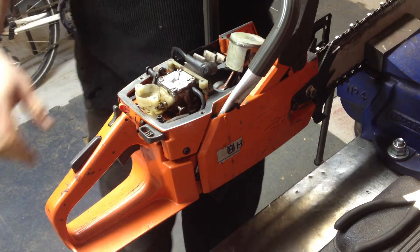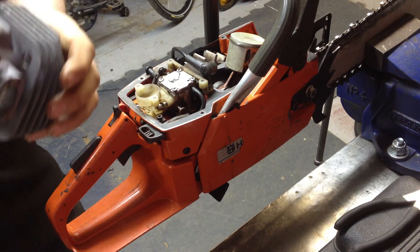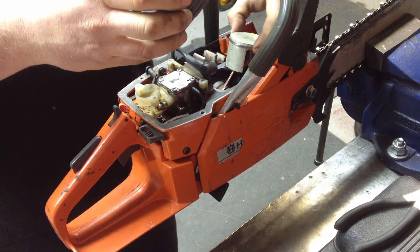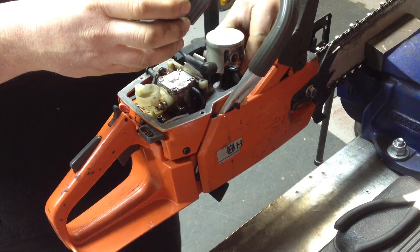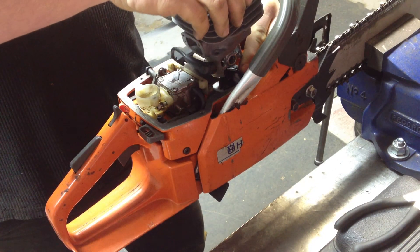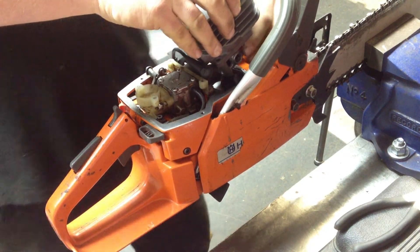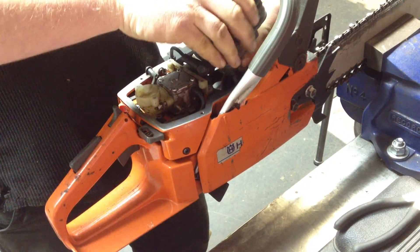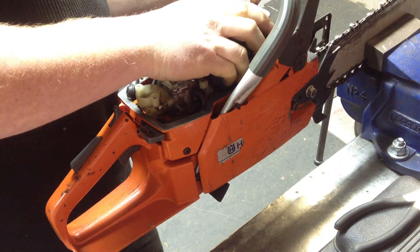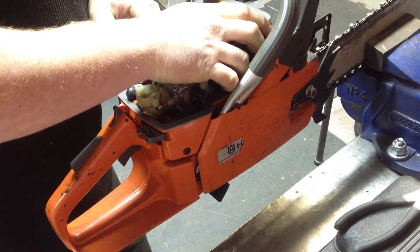Then we take our new cylinder — it's also a good idea to put a little tiny bit of lube in there. Figure out which is your front and which is your rear; I believe in this case it goes like this. Now you've got to be careful. You want to stand your piston up so you can hold it from underneath. Make sure that your pin and your locator grooves don't move. You want to very gently slide and squeeze those rings up into the jug — when you get it you'll know. There it goes. She'll kind of very gently slide down like that. Careful not to twist or scrape the gasket or get it caught anywhere it shouldn't be. Drop it down on top.